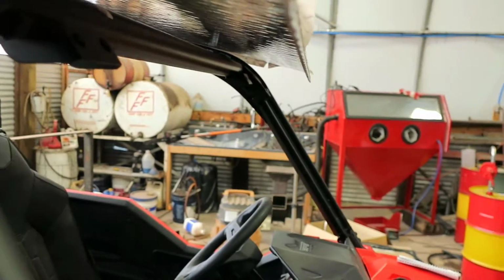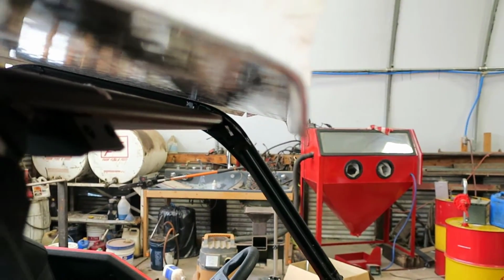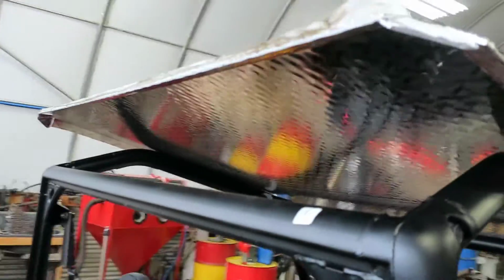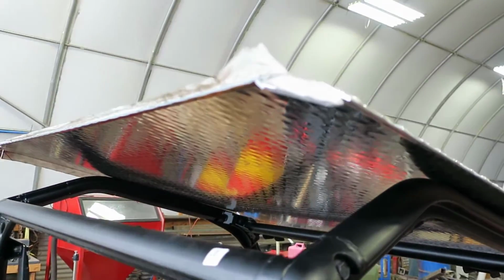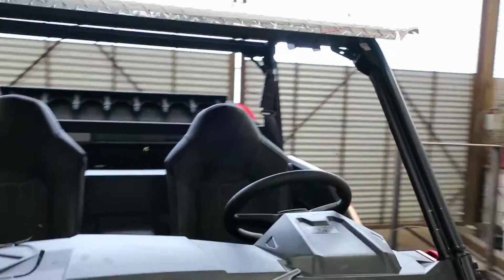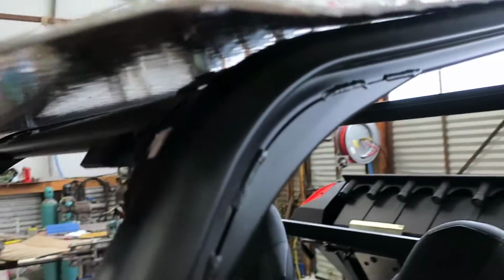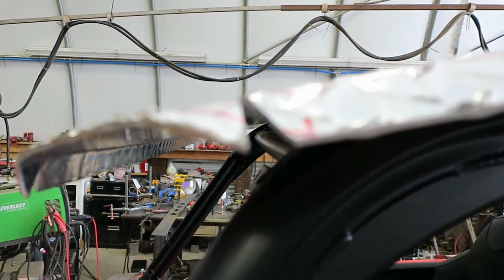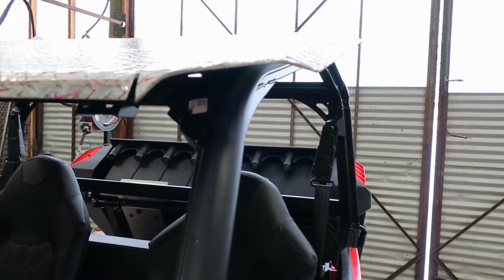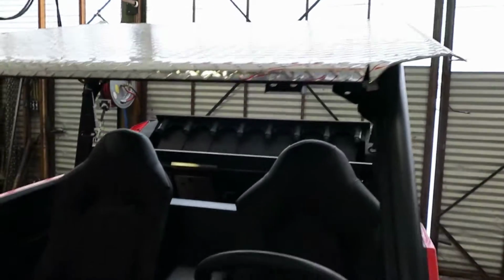And the front here, I bent it so it's perpendicular to the machine, and we also did the same on the back here. I'm still going to have to hand bend these corners down, and then we'll be welding these little slots up. I was guessing, and it looks like I got that one too big, so we'll have a little bit of filling in to do there. They kind of got bent up because my press is only 48 inches, and that's 56, well, maybe 55 after I had those bends in there. So that's where we're at with that.